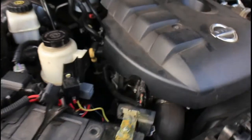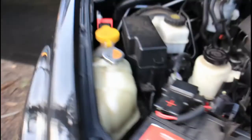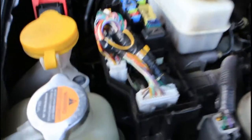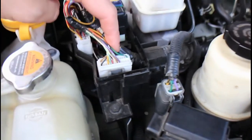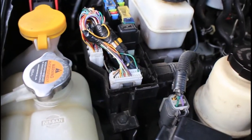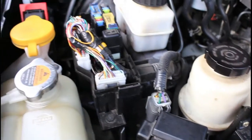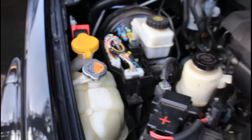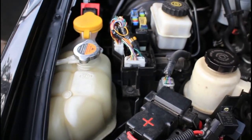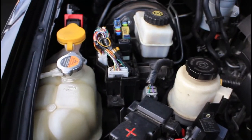Now there is another way — I don't plan to leave it with plugs disconnected. In this junction box here, this front plug — this green wire — disconnecting that wire will disable the smart charging system in a Nissan Navara D40 2.5 turbo diesel. So I think what I'll probably do is put a switch in that wire, mounted in the cabin. During the week driving to work I might keep running the smart charging system hoping to save some diesel, but on the weekends when I'm using the fridge or camping, I can then open that circuit which will make sure my auxiliary battery always receives charge.